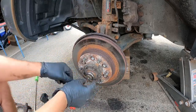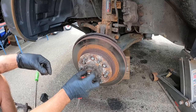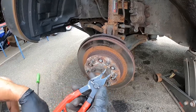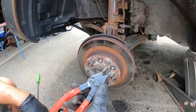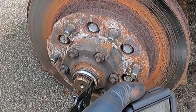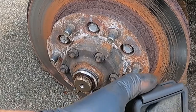That pops off. There's a little O-ring right there — this one's still in good shape. So we'll just put a little lubrication on there when we go back together. Now you're going to need some snap ring pliers to take the snap ring off. Just like that, and it just slides off.